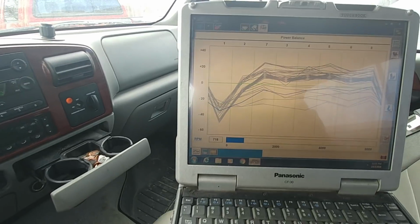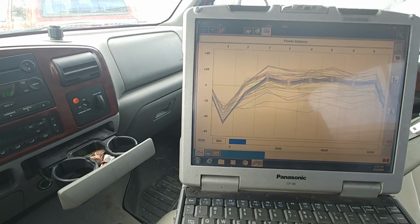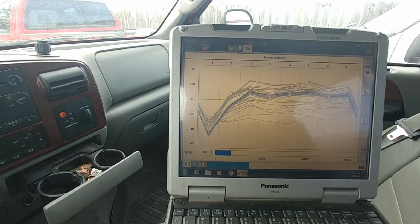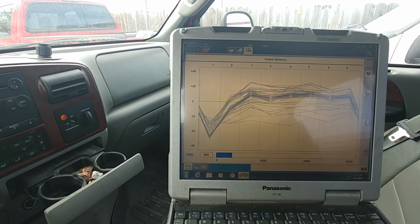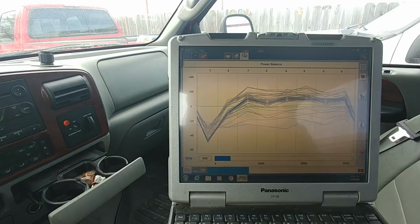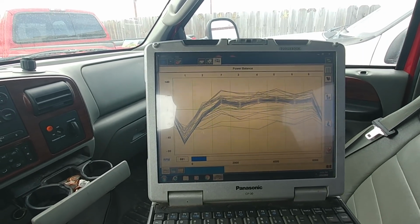Let's get that oil filter and cap done. Quit using that junk. That's junk. I call it junk when you lose an IPR valve because all the crap gets stuck in that, and the IPR valve goes bad because you're not filtering all the oil. But whatever. A lot of people have got to learn, which I understand. I do a lot of stupid stuff too.